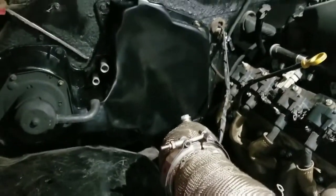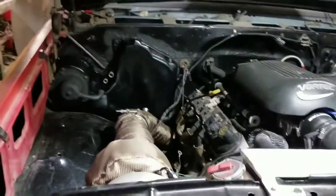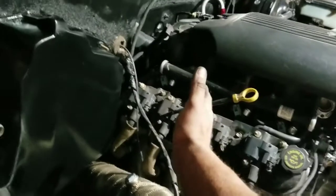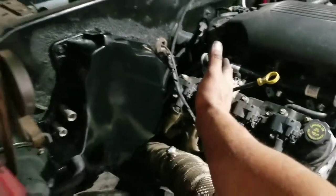Got the heater box all painted and installed. You can see how much smaller it is - if you're familiar with these C10 air conditioner trucks, that box stuck out probably to about here. Now I'm about to paint this bumper filler and I'll show you guys how those body lines turned out after I masked them out. Probably another two weeks or so and we'll be firing this truck up. Now I can hook up the heater hoses and fill it full of coolant, and we just got to do battery cables and put a good tune on it.